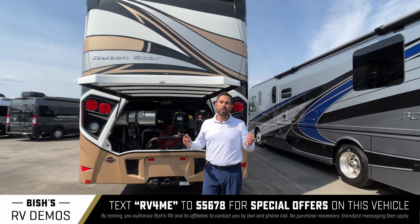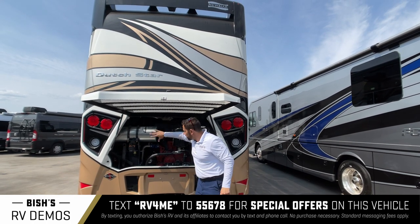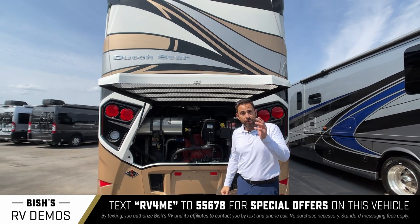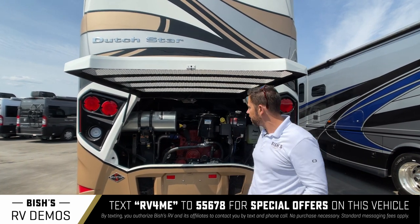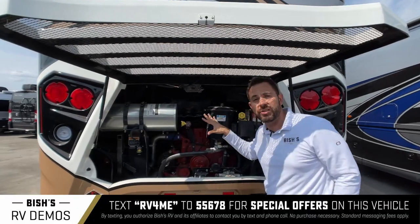Let's say you happen to blow a belt. Not to say it's going to happen, but that happens on motorhomes sometimes. If you have a rear draft radiator back here, you aren't taking that thing apart yourself to change out a belt. If you are handy by any chance and you want to change a belt and you have extra belts on board and something happens in the middle of Texas, you can reach right in here with that side draft radiator and take care of this yourself.